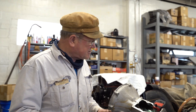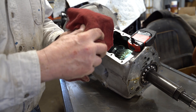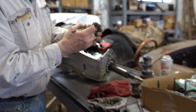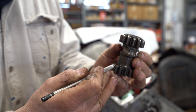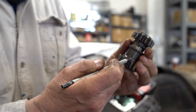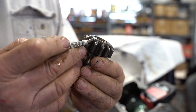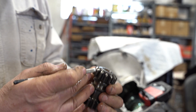Let's take a look. This is like a 1979 gearbox — in fact it's a '77 gearbox, all-synchro MGB. Here is the reverse gear, and I'll use this as a pointer. You can see that these teeth are pretty mangled — some of them more mangled than others. Let's compare them to the teeth down here: the points are gone on these teeth at the bottom. These engage the main shaft, but this engages the lay gear, so these teeth aren't as bad.